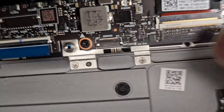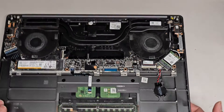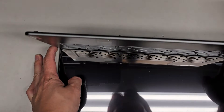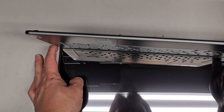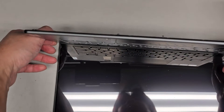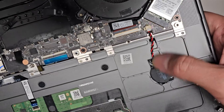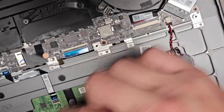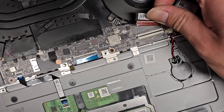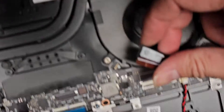There's another place where they had a debug connector, but there's no connector there. LCD LVDS connector — if you're going to mess with this, what you want to do after disconnecting the battery is open up the laptop and then press and hold the power button for at least 15 seconds. This will make it a lot safer to work on. So I'll hold it for a few more seconds. Now that I held the power button, we can safely flip that latch up and take that out if we need to. I'm just going to take it out and put it back in because the display is not coming up, just in case that's causing some issues — sometimes it can be some dust.